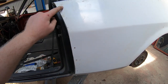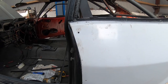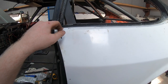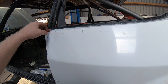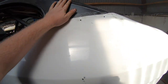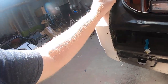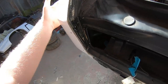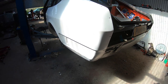The next stage is to plug all these holes up where the screws were. The paint man has advised me to fill those with body filler, let them harden and sink, and then he'll go over it again when he's doing the rest of the filling over the kit to give it a second coat. Overall I'm fairly happy with that — it seems to be rock solid. I just need to get on and do the other side now.